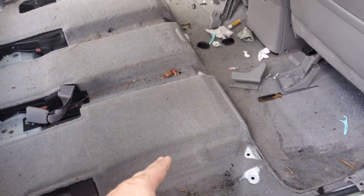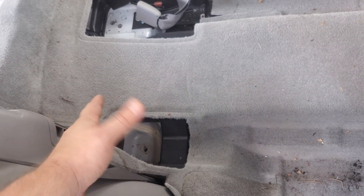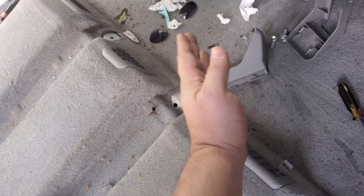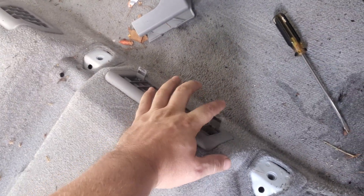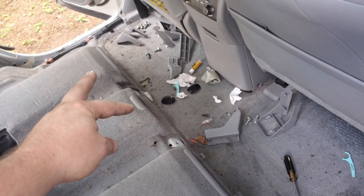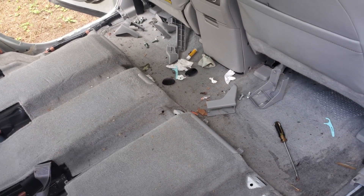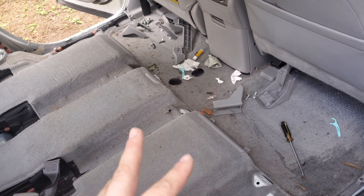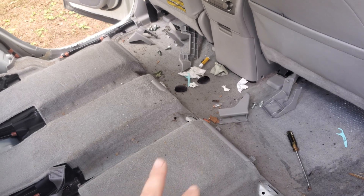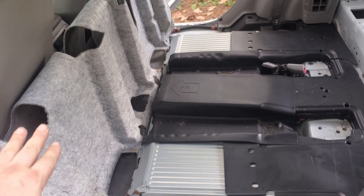Before pulling this forward — actually it does come out pretty easy, so I don't think you have to take this panel off. But you do have to take your vents off. Pop these forward with a screwdriver — there's a 10-millimeter in each one. You should be cleaning these little screen filters about every oil change, or more often if you have dogs or a dusty environment. Let me get these pulled out, roll the carpet forward, and see what we've got.